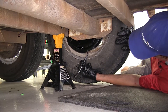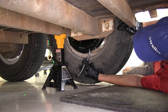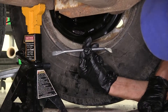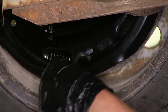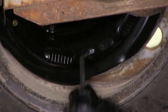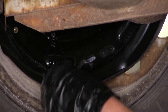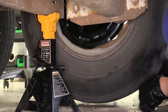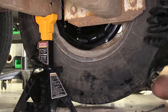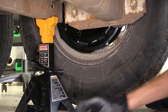Now that everything's installed, we need to do our initial adjustment on our trailer brakes. Once we have them adjusted properly, we don't ever have to worry about adjusting them again because they are self-adjusting. So we'll take out this back cap here and use a brake spoon — we have these available on our website. We'll adjust our star wheel adjuster down and rotate the wheel to make sure our brakes are starting to grab more. Once we have light drag on the brakes, we know they're adjusted properly. We have light drag now — I'm putting a little bit of effort into the tire to move the wheel assembly. Once we're right about here, our brakes are properly adjusted and we can reinstall our dust cap.